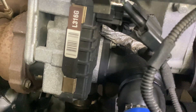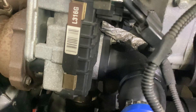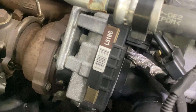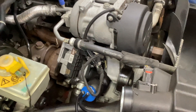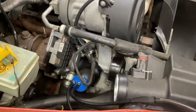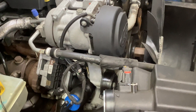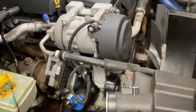That's pretty well it. So to summarise: turbo hoses — two to check — plus the elbow, plus the split intercooler, plus split or blown turbo, plus turbo modulator which you can't buy on its own (I get them from the UK), and the harness plug. This one I'll change out the turbo today. My remanufactured turbos come with a brand new turbo modulator, and if I think the plug is a bit suspect I'll do that at the same time. Any questions, put them in the comments. Thanks for watching.